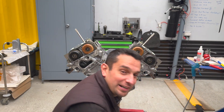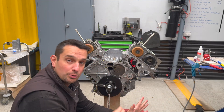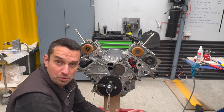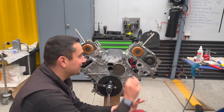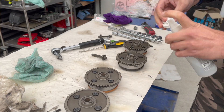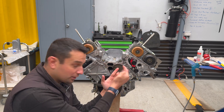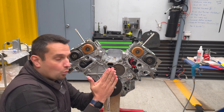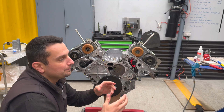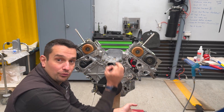Technically we're all set. One reminder — this isn't in the books, but something I always do: carefully clean the back of the sprockets where they attach to the cams using isopropyl alcohol and a little rag. Even though there's a lot of oil circulating through the vanos sprockets, where they actually sit you don't want any movement. So I clean the surface as much as I can before putting them together.